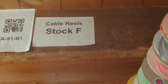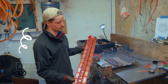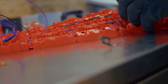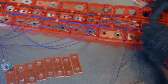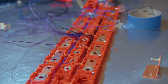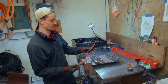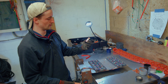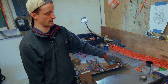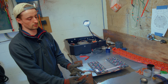We're in the wiring room here, currently working on all of these bits for the Series 1 that's currently being put together. We've got this out of the Leaf pack that was stripped last week by Fred and the other guys, so all the modules you saw earlier were out of that. From this, we like to recycle as much as we can into the new car. So all of these bus bars will be reused — that saves us having to make new ones. They're all perfectly good to go; everything from the battery out of the crashed Leaf was in perfectly good condition. So these bus bars that we've taken out of the Leaf are going to be used, with the little ones spanning between two of the modules to connect them in series, and then these large ones go between the two banks of the pack to connect those. And then there'll be a high voltage cable from each end of the pack that will go to the connectors.